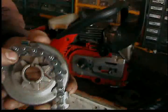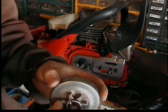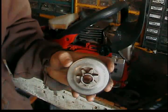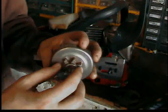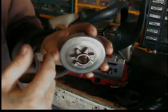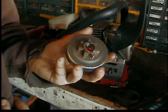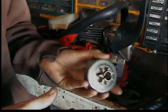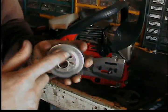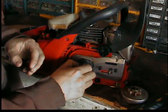They sell rim sprockets — the smaller replaceable type — for only about seven dollars, but you have to buy a new assembly first. It's worth it in the long run because they're little round discs you set over the sprocket. This whole assembly with the larger star is around 30 dollars, so the initial investment of 30-38 dollars is well worth it instead of spending 30 every replacement — you can just spend eight because only the outer ring wears out.